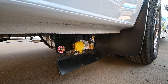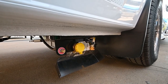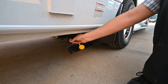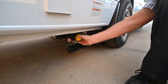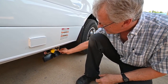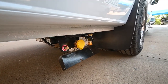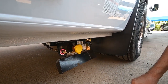When you want to get this tank filled, look at your gauges inside when the tank gets low and you need propane. Pull into a filling station that offers propane and they're going to fill it here and vent it here. It has an odor to let you know if you had a leak on the propane side. There's also a quick disconnect here where you can hook up a quick disconnect LP hose and be able to run a barbecue grill outside. The lever is in the off position right now but it would just snap into that fitting.